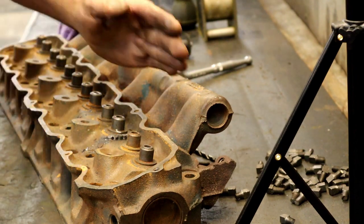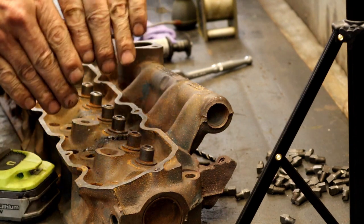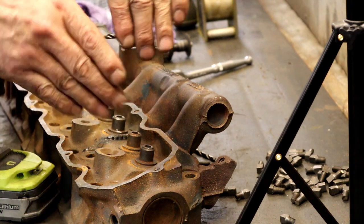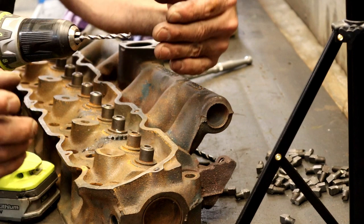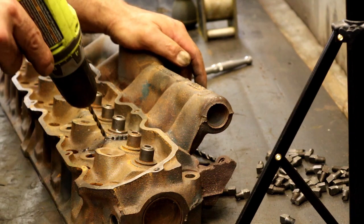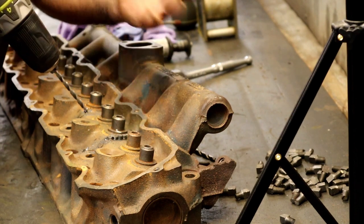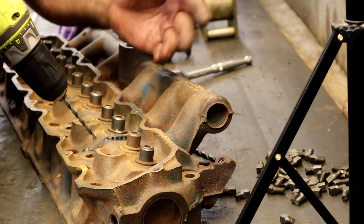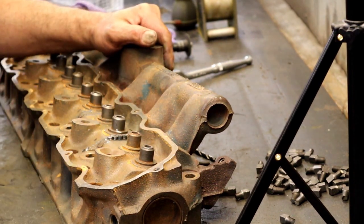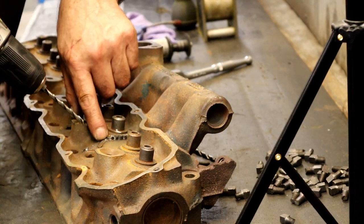When you go over a hump, you're gonna go over a hump with the plugs. If you were to stay perfectly straight, you could start cutting into the plug quite a bit. So I'll actually go one way, another way, one way, another way, around a turn. Little tip: put one plug slightly angled that way, one plug slightly angled that way. If you go perfectly straight, you're drilling into the old plug, which is not a problem, but you don't want to drill all of it when you just have a little area that you're drilling. I'm right in the middle where I want to be. I could show you again, but I think at this point you understand what I'm saying by seeing the crack.